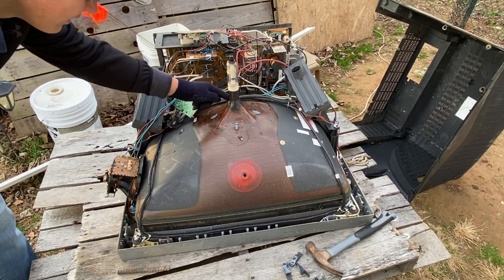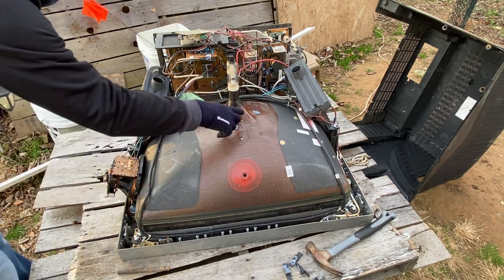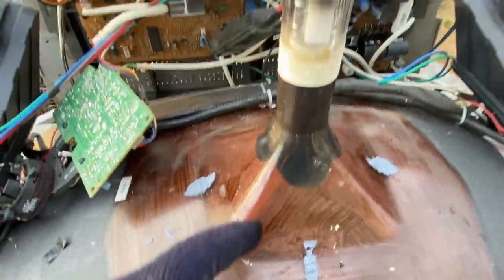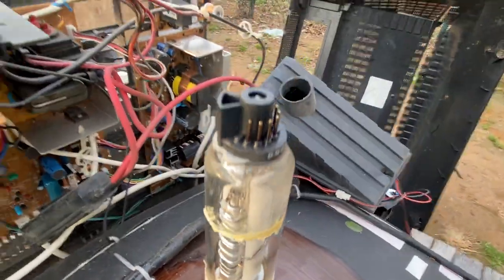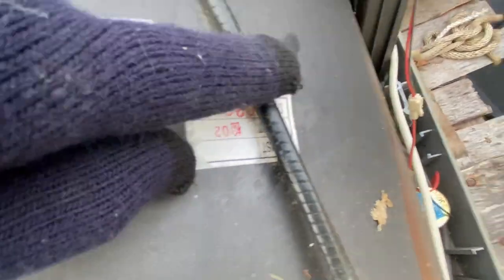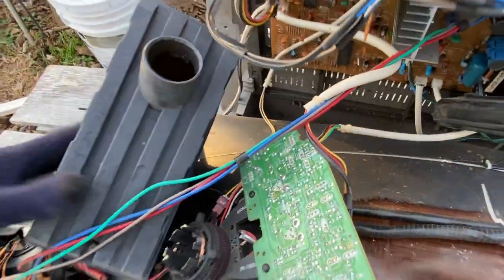The neck connection to the main tube — you see that? It's square. Look at that, I've never seen that before. You can see the electron gun, everything is taken off, and here's your yoke. Now we just got to work on those boards right back there. Everything is discharged. This here is just a ground charger — there's copper wires in here with electrical tape wrapped around it.